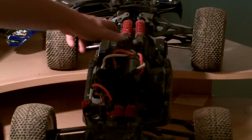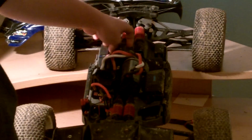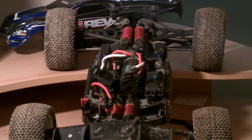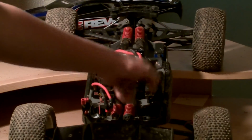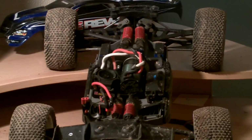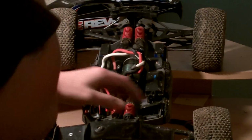Right now each one does about, I would say, 120 ounces of torque. I'm probably off by maybe 20 or 30 ounces. Give 5, take 20, I don't know. They're not very strong servos and they're not very fast. I would recommend upgrading to a Spektrum, a Savox, or a Hitec, something with at least 340 ounces of torque, so you can run just one servo instead of dealing with the wire harness in the radio box, because it takes up a lot of space in that box. If you don't know what I mean, it's where both servos plug in, and it's basically a Y harness, a really big Y harness, so it takes up a lot of space.